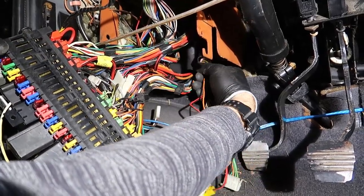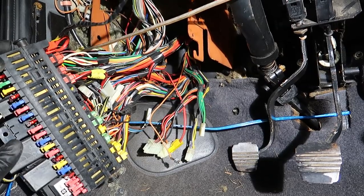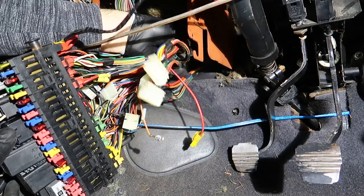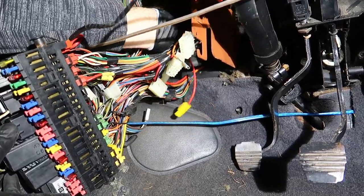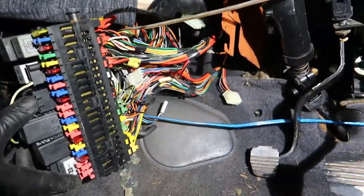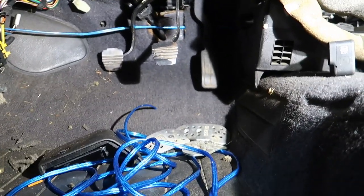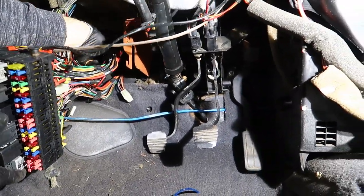And look at that. As beautiful as it is, there were no wires that needed to be cut. That was the first top plug. Perfect. Take your time with the plugs. You can only do one plug at a time. I just went slowly. When I unhooked the rubber grommet from the firewall, it allowed me to do this. And what's awesome about it is you cannot plug something into the wrong spot. Something like the power and ground, you could potentially, but the plugs are very simple.